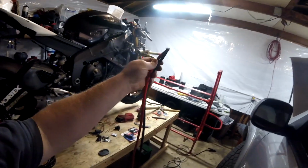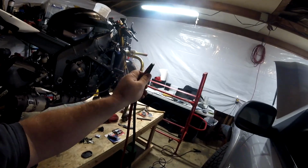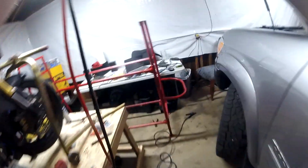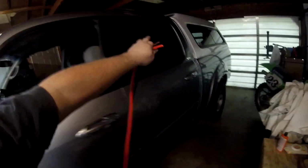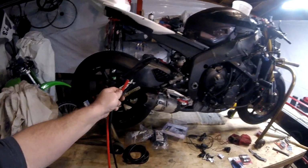They are post-fuse, people. So if they rub together for thousands of years and millions of miles and actually start touching each other through that insulator protector, and that were to happen, it'll pop the fuse in the front, and it'll pop the fuse in the cab, or in the camper. Both ends will die. And that whole section of 12 volt hot wire will go cold, okay? And then my battery will stop charging, and I'll use it and wear it down, and it'll be dead. And I'll say, why is my battery dead? Why is it not charging? Something must be wrong with the charging system. Oh, both fuses are blown. Oh, I must have a short. Oh, there's my short. My wires touched each other.